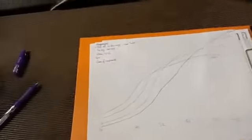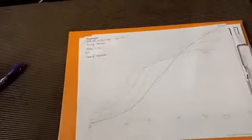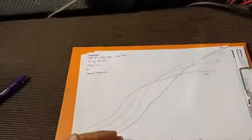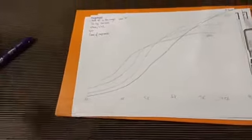You may need a bigger camshaft and a bit more flow on your exhaust side to balance it out. Without getting more complicated, the other way I split the camshafts and run different ones is, say I'm thinking between running a 256 and a 264 and I can't decide. I might go a 256 inlet, because the inlet's the more predominant one that's going to have the most influence on how it runs. And then I might go 264 exhaust. So it's going to end up somewhere between a 256 and a 264, sort of halfway in between. Generally, if you can't decide, it may be an option to go a little bit bigger on the exhaust side and mix them up that way.